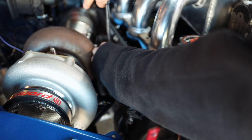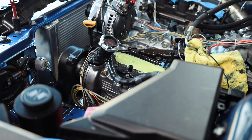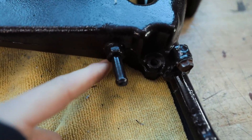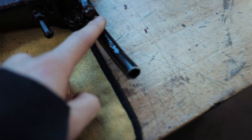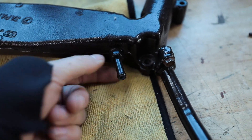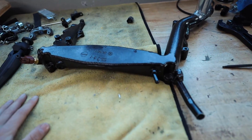We also need to pull off the coolant crossover tube because we have a little modification to do. A couple things are going to happen here: I need to plug that port right there, and I'm also going to cut this guy off and drill and tap it for a 1/8th NPT plug, so that in the future if I need to run a coolant sensor or something, we have a 1/8th NPT right there. This is going to be our return for our AOS coolant line back to the radiator. I need to powder coat it again because I totally forgot we welded that on there.